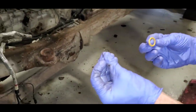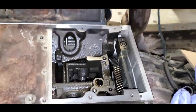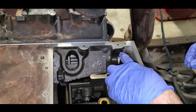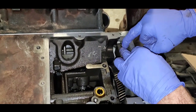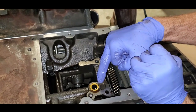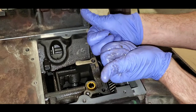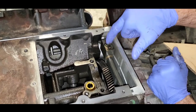Now let's put the new o-rings in. This one goes into the branch tube, this one is the feed one — remember I was telling you about the yellow one. They're not hard to mix up; they only go in one spot. When you take them out, this one can be kind of sticky in here. Same with this one — this is the branch tube right here. Remember I was showing you guys oil flow from the oil cooler on that last video, and it feeds the pump. The pump outputs and comes out that jam nut fitting, and the oil pressure goes down into here, goes into this tube, goes this way and up into the cylinder heads, and then feeds the injectors — high pressure oil.